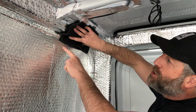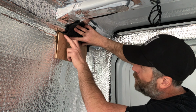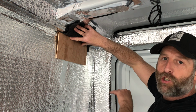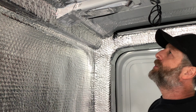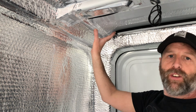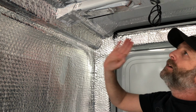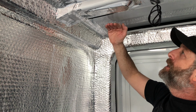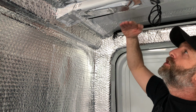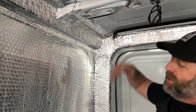I go about an inch past, so when you do put your panel up with carpet, you're getting a really nice finish. Now, I'm going to carpet first of all, then I use Celotex 50mm insulation in the ceiling itself, between these gaps here and here, all the way along the roof. 50mm fits just nicely, just where the rib on the highest point measures 50mm.